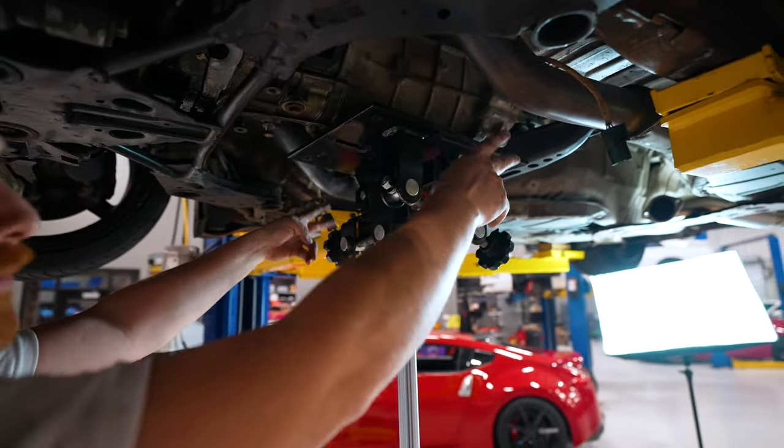And so third, fourth, fifth, sixth, reverse, good to go. After that, triangulated rubber boot, I'm gonna slide it down on over the shifter, maybe a little on the tight side, just kind of press it down, don't worry. These things are really resilient, it's really hard to rip them. Rubber over all four bolt holes. Then this bezel is supposed to go on top and hold it down like that. And then that on top.